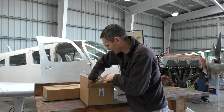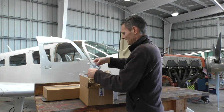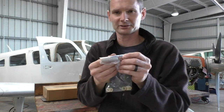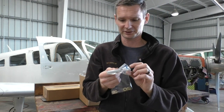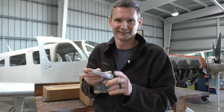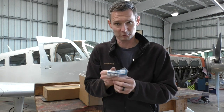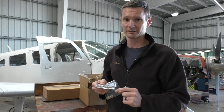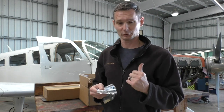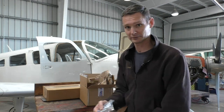And we got some washers. And this is the oil pressure spring that I bought because when I thought that engine was a little low on oil pressure — the white one is a stiffer one, that will give me more oil pressure. However, now that I found out it's the actual oil gauge that's giving me the false reading, we're going to put the original one back in there with no washers when we fire it up and see what it does. But now I got another oil spring.